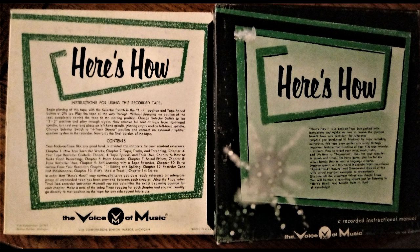Frank, is it true that threading a tape recorder is difficult? Oh, no, Bob — not unless you have ten thumbs. Thread it once and you're the master. Here, let me show you how to do it. First, we'll put this blank reel of tape on the supply or left-hand spindle. Now, let's unwind about 18 or 20 inches of tape and hold the end between the thumb and index finger of our right hand. Just above the index timer to the left of the push buttons, you'll notice a little line on the escutcheon. Place the index finger of your left hand just behind that line as a guide for placing the tape in the slot just above the push buttons.